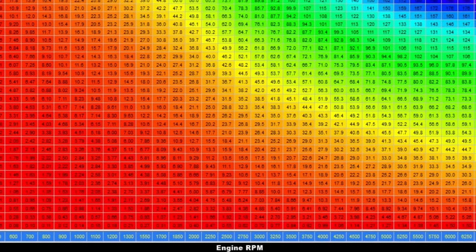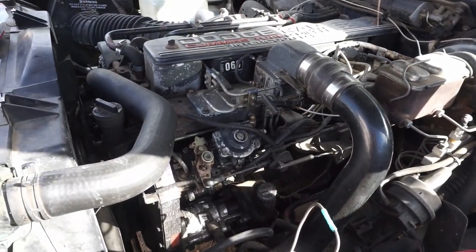I'm looking at a turbo that usually sees around 30 to 35 PSI on this relatively stock engine. I'm only getting 15 PSI, which is huge. And for gas engines, yeah, the biggest consequence here is that you're not making as much power as you could be, and you're messing with fuel mapping and all sorts of stuff because it's not getting the air that you would hope. But on a diesel engine, the consequences could be bigger.